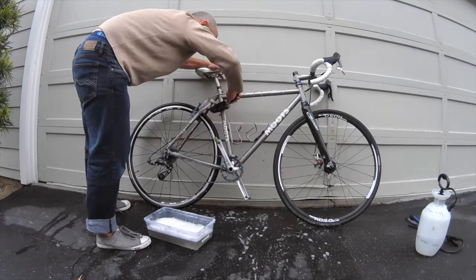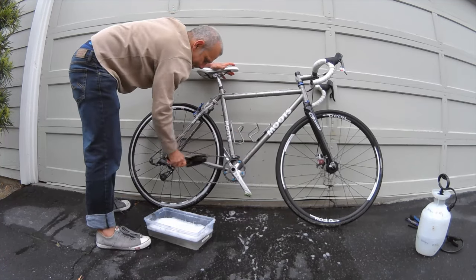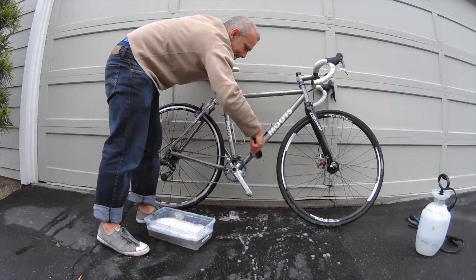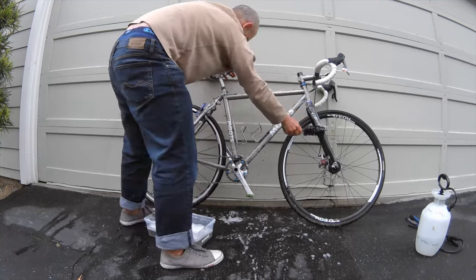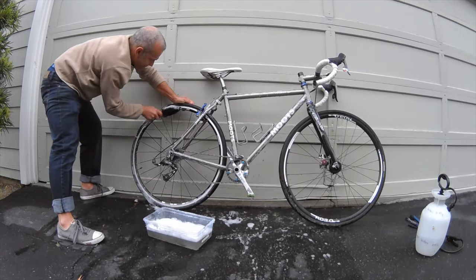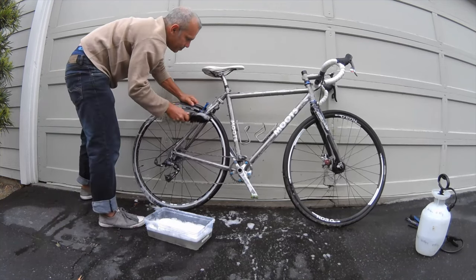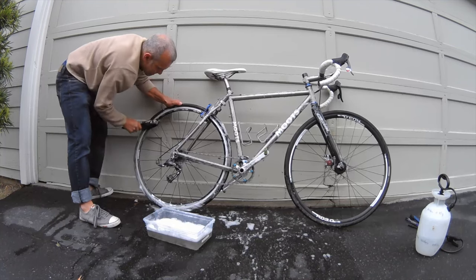This should be a good example of how fast it should take to clean the bike. If you have a carbon frame, do not rub hard on the frame — just go really gentle, don't go back and forth too many times and you should be fine. I'm getting the braking surface, so that should be good. The chain came off — that's why I spun the tire there — so I'm cleaning things up.